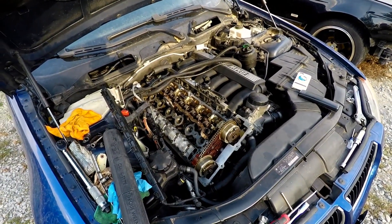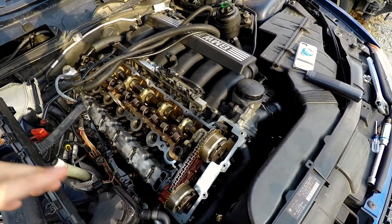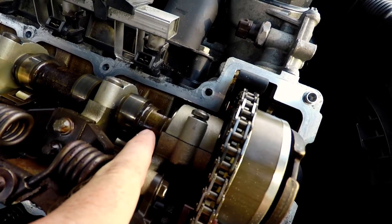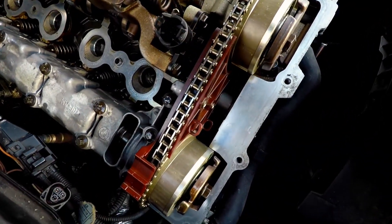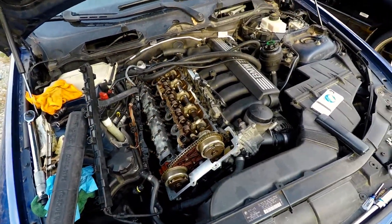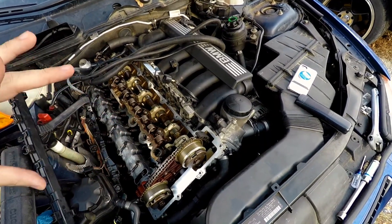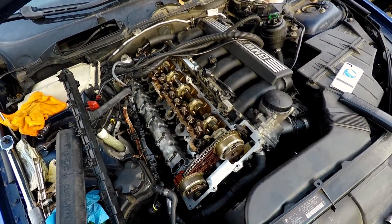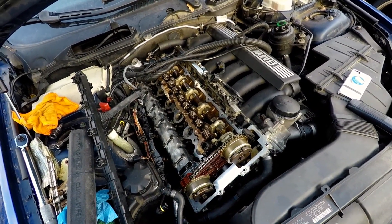We're going to re-torque those and then the camshafts had to be turned a certain way — there are little QR codes on top of them before we could drop the timing unit on. There's a little black square, like a QR code, right there — those had to be facing up on each cam. You can barely see it on this one, but it is facing up. At this point we're ready to torque everything, put the bridge jig on top, set the vanos jig on the front, put the main chain tensioner jig in to put a little tension on the chain, then set the timing.